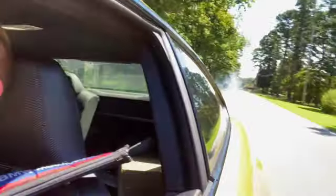Okay, so the final step is to take it out now and drive it for at least 10 minutes at highway speeds according to the directions. What I'm gonna do is follow the advice on Bimmerpost, and I'm going to drive it in lower gears than normal. So I'm gonna keep that internal combustion temperature up, hopefully help burn off some of those carbon deposits, and just drive for 10 to 15 minutes, a little hotter revving than I would normally do.